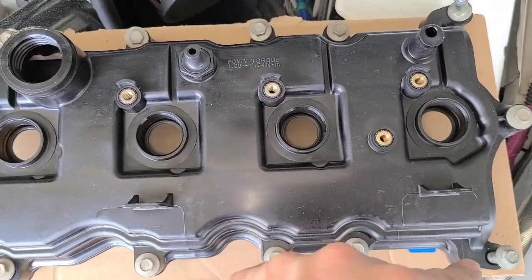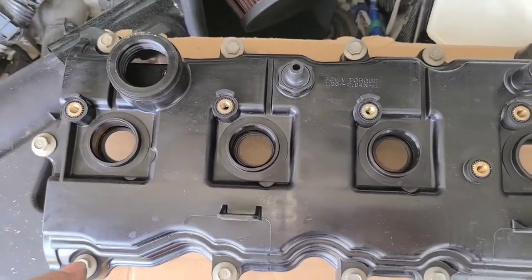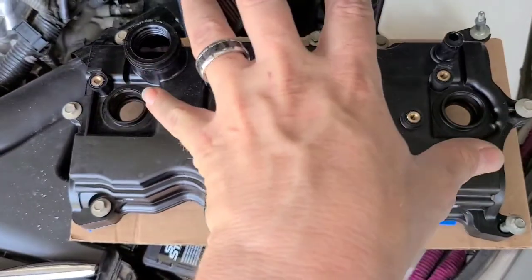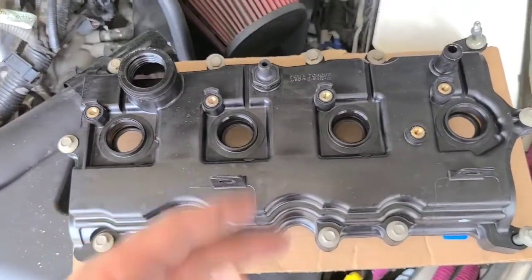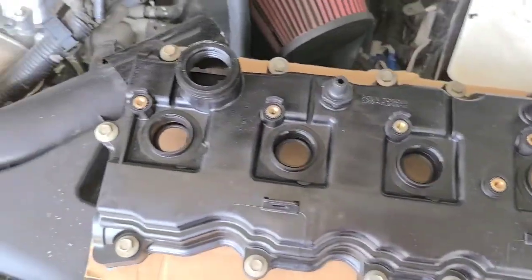then here, there, there. So you're gonna start from the outside and kind of work your way in, taking those bolts off if you're going to reuse it. If you're not going to reuse it, it doesn't really matter. I mean, you can beat the hell out of it, just trying not to damage anything underneath.